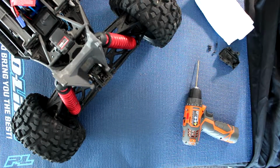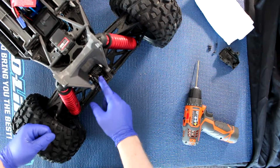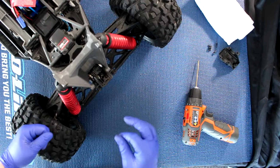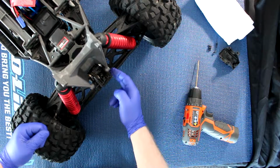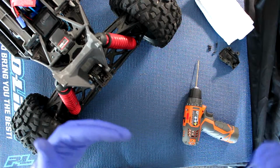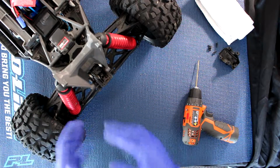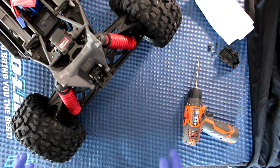One important thing. I know you can see it here. Remember on what side the ring gear goes. Because when you're going to put it back in, if you put it opposite side, it will fit. Both wheels will fight each other now. The back one wants to go forward, and the front one wants to go backwards. Kind of bad thing. Easy to swap out back if you do it, but you don't want to do it.